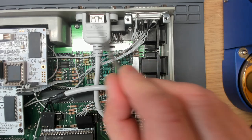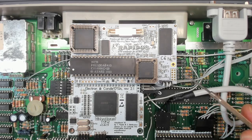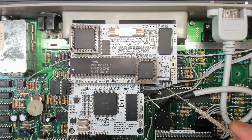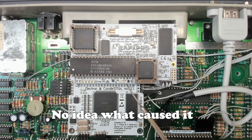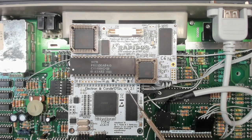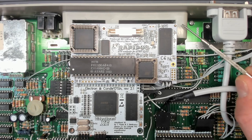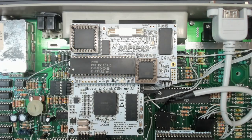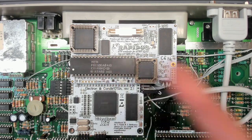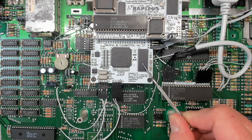The Aki interface is also here with a USB connector, which we'll get into later. Likewise with Rapidus - rewired, only three wires but they look smarter now. I added an extra socket on the stack of sockets under Rapidus because it was sitting too low and hitting the back of the casing, which was enough to create serious problems since it's a CPU board. VBXE was the most challenging thing in this machine.